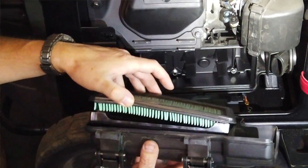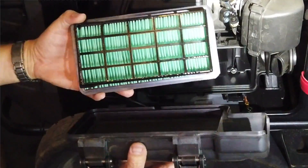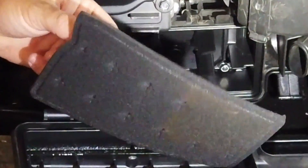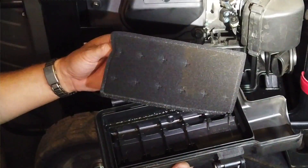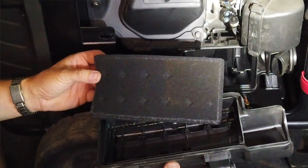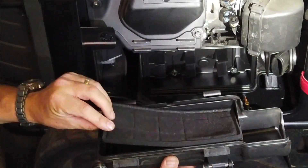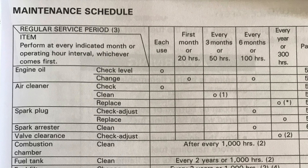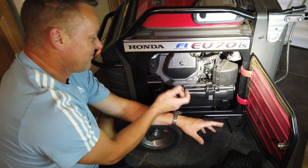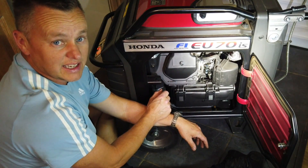It's one of those where not every shoe fits every foot. If you're running this in a really dusty environment — if you're a motocrosser on a dirt track with lots of dust in the air — the air cleaners are going to fill a lot quicker, get a lot dirtier. If you're running this in a clean environment, like tarmac car parks, it's just not going to get as dirty. And if you're running the engine at full pelt, really revving it and getting lots of power out of it, it's going to fill up a lot quicker. All good — good for another 400 hours.